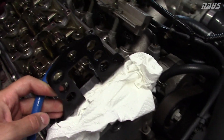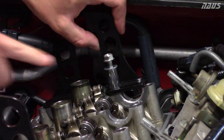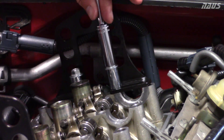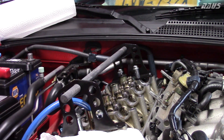You can see the spacers in there. This is the gantry brace - you put one on each side of the engine and put a rod through, then you have a cantilever lever to work off that rod to compress the retainer. I'm angling them away from the engine for as much room as possible. Drop that down - you can see how much thread you're biting into. Snug them up and now your gantry system is in. The iron rod just slides through the entire thing - grab the last pieces and you're all ready to go.